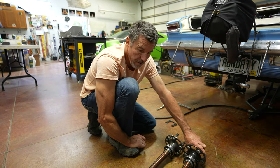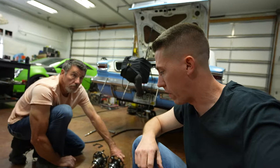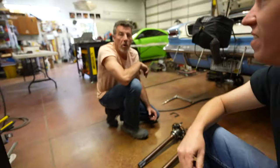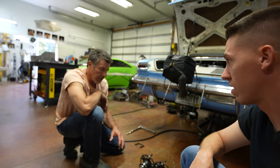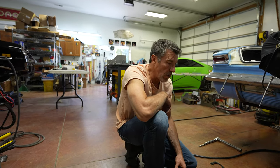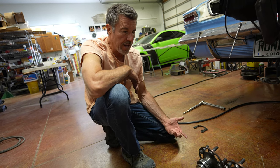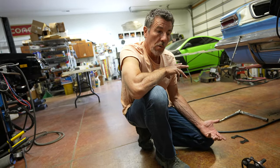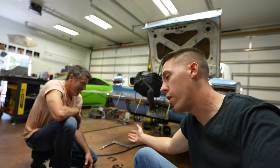There's no way I would have bet any money this would have ever had an axle problem. And so also — if we would have pulled it out and just seen twisted axles, we'd have probably just been like, okay, I guess we need new 35-spline axles. But seeing that it totally broke it, bent it, and tried to turn this thing into a pretzel — now I called Mark Williams up, got some new parts. Going from Strange to 40-spline, there'll probably be a solid axle now, changing the whole center section, going back with the 3.25 gear. That's where we've been, and I can still drive it on the road. Just built a little bit better — more safety.